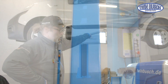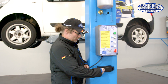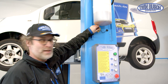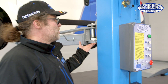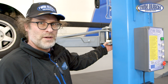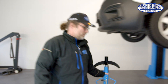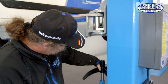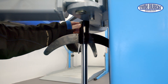However, the following problem can appear while lowering the lift. In this case, the carriage and the vehicle have to be lifted up a few millimeters in some way. A suitable lifting device is required for this. When the catch is free, continue the process as shown before. While lifting with a lifting device, make sure to set the device only under the carriage, not under the arms or the vehicle.